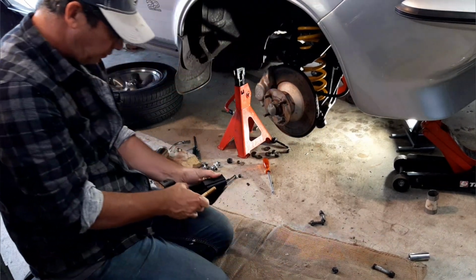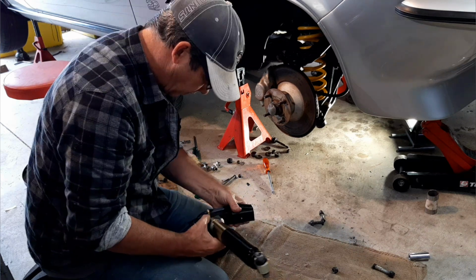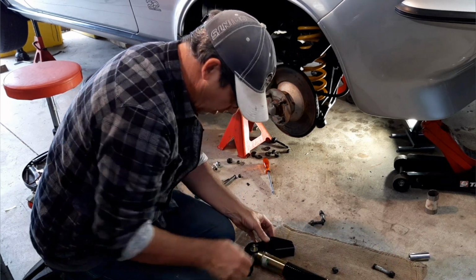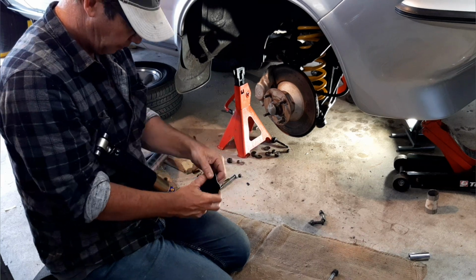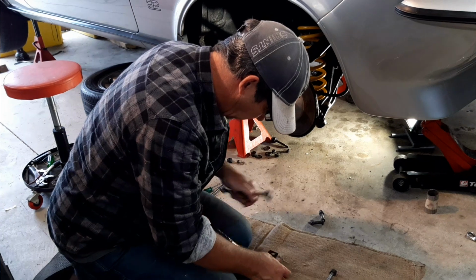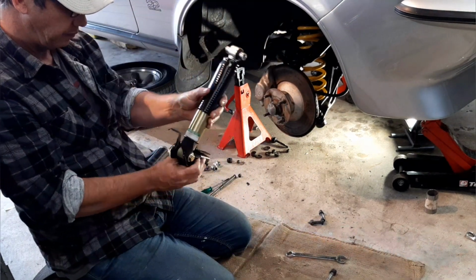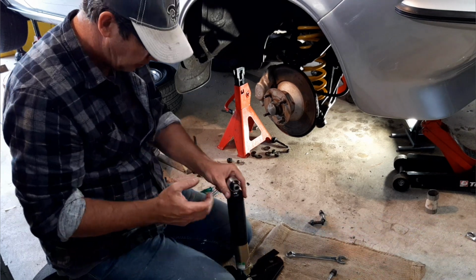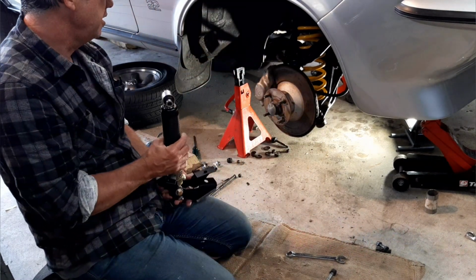Washers. That's the right orientation. Shock absorber with the adjustment knob to the inside. Like so. Another washer. And then also picked up lock nuts. Right, so that's there. I'll do that up a little bit more. Okay, that's that assembly. Let's place that top. Now I can insert this lock nut into the position, but I'm going to have to jack it up.